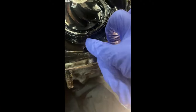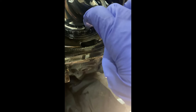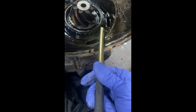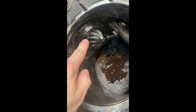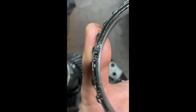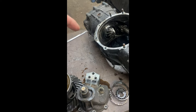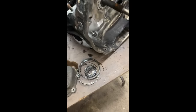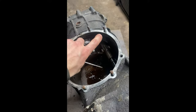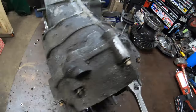Once it's tight, it spins together and this slides over and engages the splines between the two, connecting both shafts — very interesting. The nut on the inside is peened into the bearing race, so we have to come in with a chisel, knock the peened portion out, and hit the nut on an angle. There's a special tool for this but I don't have it. I took the pinion nut — you can see it's threaded where it's been knocked into the pinion — then I used a hammer and hit it on the edge to pull away the material that had been pushed into the bearing race locking it. You can see the divot in here. Then I used a drift and spun the nut out. Now we're going to start separating the rear end of the case.